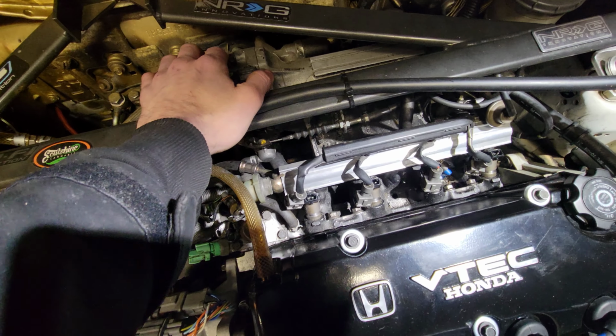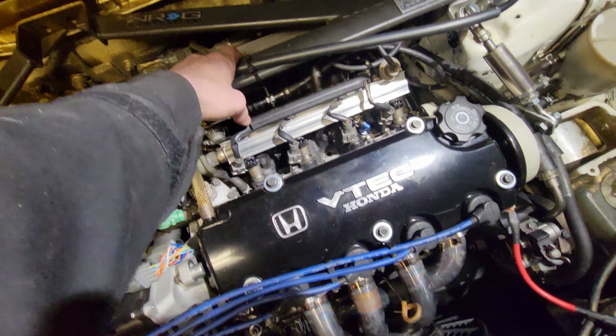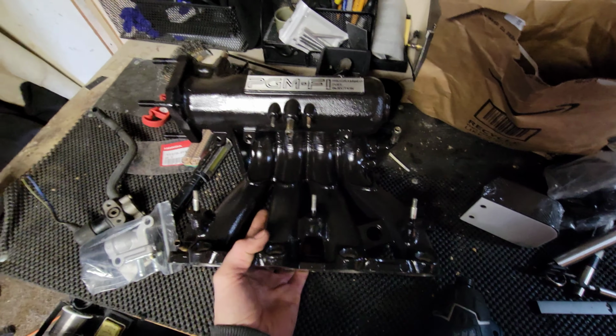So what I'm going to do is take this guy off of here, tear it down, get it all painted, and then once the throttle body comes, I can figure all that nonsense out. But as far as keeping the injectors and all the wiring the same, I have a feeling it'd just be easier to use that throttle body. The only reason I really wanted to use this one is because it has shorter runners. It may be 1 or 2 horsepower; any little bit here and there helps. Shorter, it's lighter. Obviously it's a lot prettier, but at the end of the day, it's going to be a lot easier and pretty much the same result just by using that guy. So unfortunately that's where this one ends, I guess, until I pull this guy off there and get working on it.